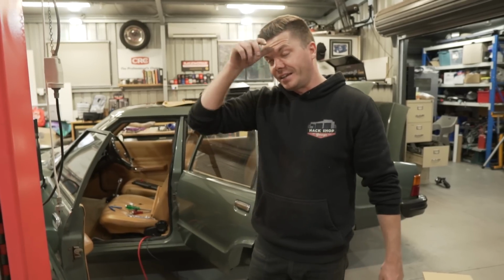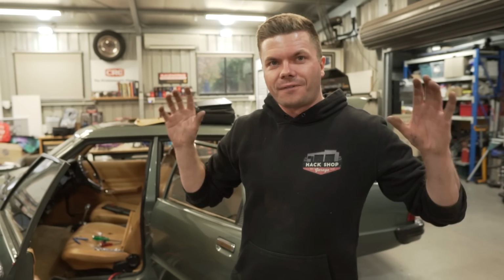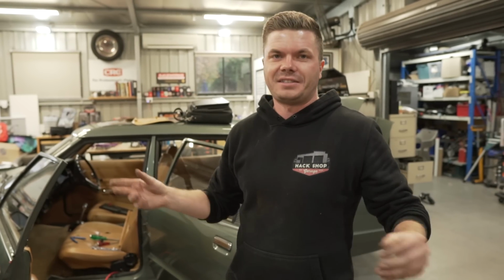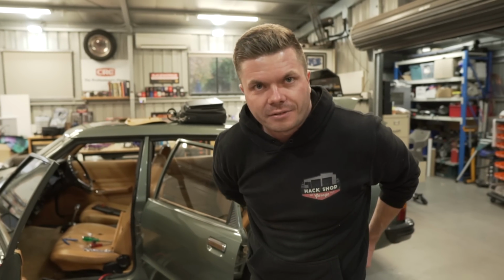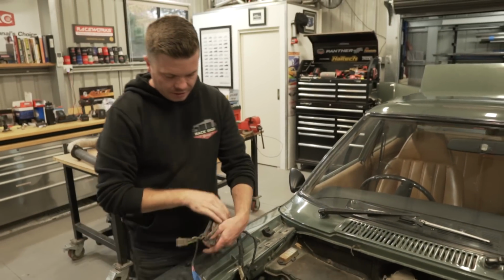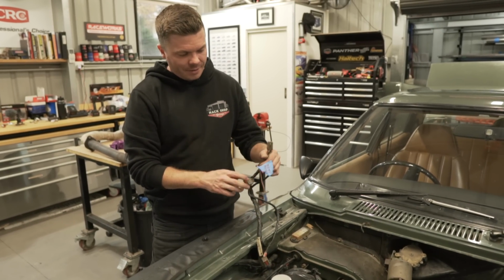Oh yeah. Big win. So I've had a look underneath the dash on the driver's side and it looks like he's honestly teed into nothing on that side of the dash. It's all factory original wiring. There's no dodginess under there whatsoever. It looks like all the wiring that he's teed into is actually being done in the engine bay or on this side. Because like I said, it's only carby, so there would have been nothing run to it. The original harness, which runs stuff like your wiper motors and whatever this plug went to, probably would have gone to the engine, because this would have been all the engine would have had. For your tacho and stuff like that maybe, and starter.